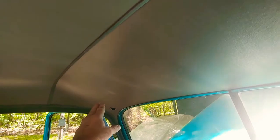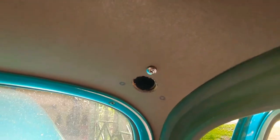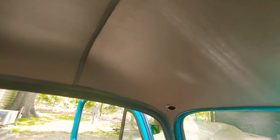At first I was trying to crimp it, but when I try to put it in here you can't get it to sit on top of the seal and seal all this at the same time — it's just not going to happen. So I put this piece in first and then I actually saw where at the top it would touch the skin of the cab. It was a little bit too wide, so I trimmed off that edge over there because this edge I wanted to leave alone since I'd already copied that hole. And that hole lines up, so it has to be up under that seal. Once I got it to bow just a little bit, then I put this piece in and I slid it forward all the way across. You have to be very careful to make sure it gets in right — that was my hardest part. Once you've got it flush up against that all the way down, you'll feel it — it'll kind of click, it would make a boom.